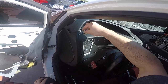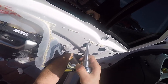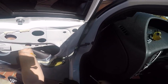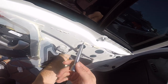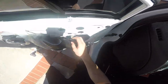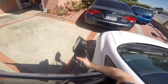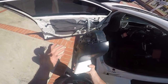All right, second one right here, and third one. You don't have to worry about the mirror falling because there's a clip on the mirror itself. There's a clip right there — just stick your hand in there, pull on the tab from the inside, and the mirror is off.